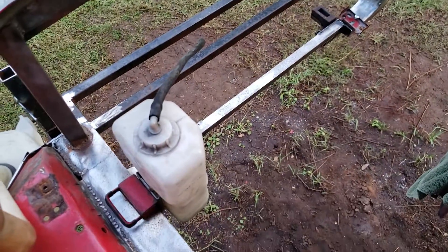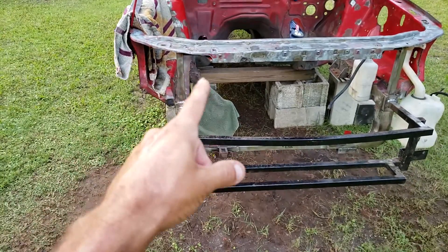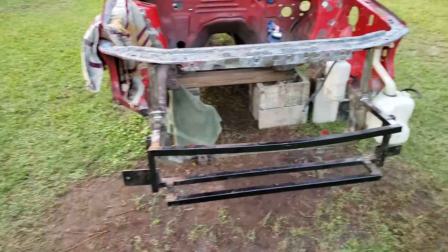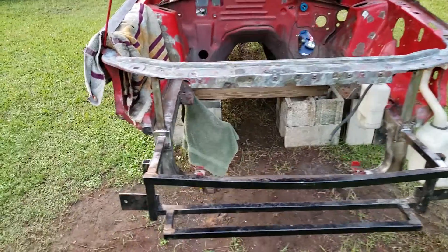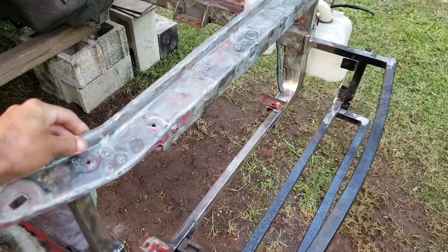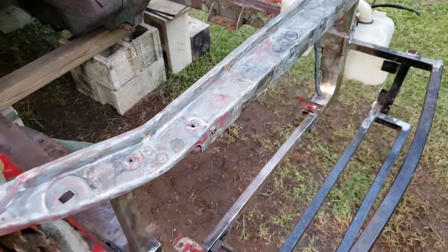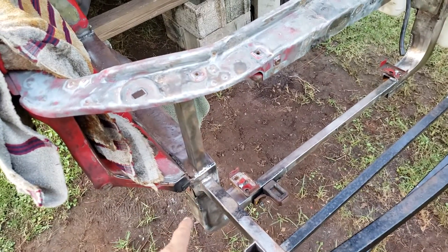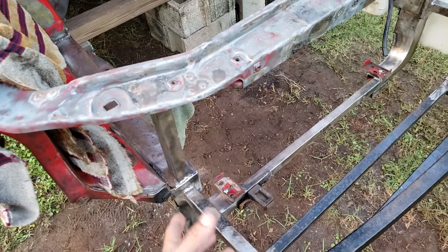It's tacked in there, so it was welded up - a little bit of progress. All that metal is taken out from where the headlights would be, and then it's just a single post that comes up. Both sides are done, holes are filled in on the top of the radiator support. I didn't get rid of this lip because it needs to be there - it gives this top piece a lot of strength. I didn't think it would, but once I actually cut all that metal out, yeah, it got a little bit flimsy.